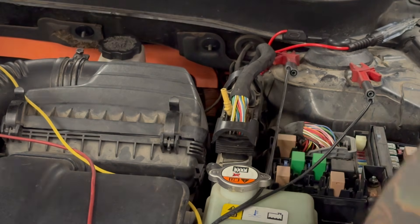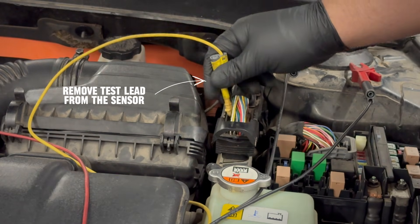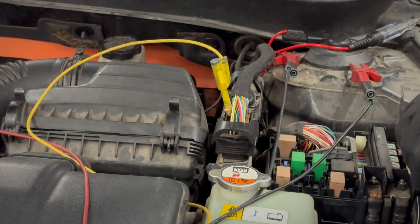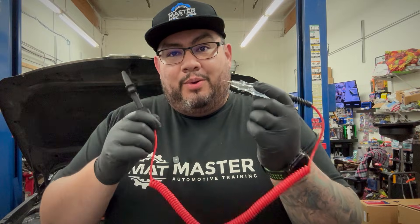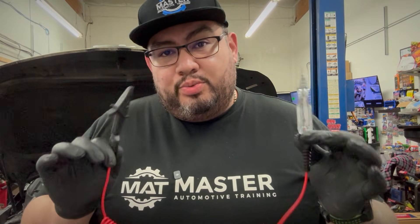So my next step is I'm going to remove my test lead from the sensor and go to the engine computer just to see if I can get a waveform. So in a previous video, you guys saw me use or talk about one of these — this is an LED test light and this one draws 32 milliamps. What I'm going to do is use this today to verify power and ground to that cam sensor. Then I'm going to show you guys a little trick we can use with this light to see if it's a circuit problem or an actual sensor problem.